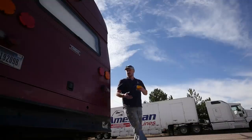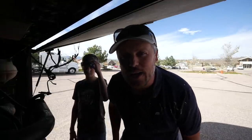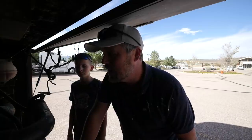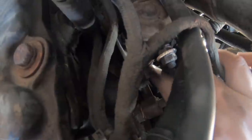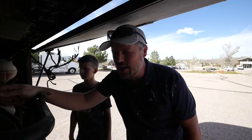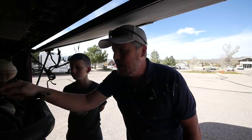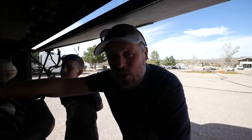About a week ago I had to do a repair on the bus. A couple weeks ago I was having an issue with my bus starting. I came back here and I noticed that there was this little device — the terminals on it were actually loose. Some of the terminals looked like they had gotten really hot and even melted. I did some research and found out it's a solenoid — the heater grid solenoid. When you turn your key on on this bus, there's a light that comes on that says intake heater, and when it's cold, that light will remain on until the intake heater has warmed up enough. This solenoid is actually the intake heater solenoid.